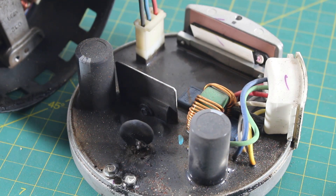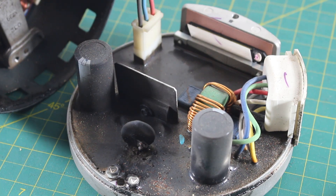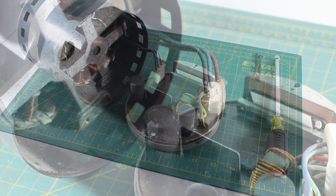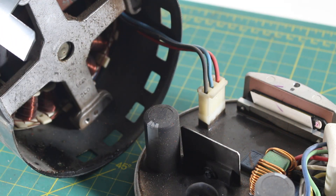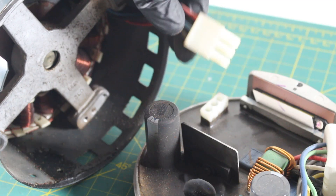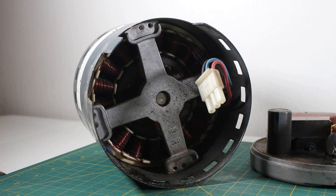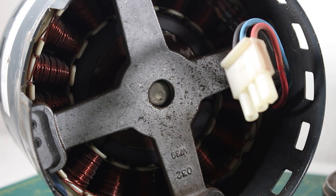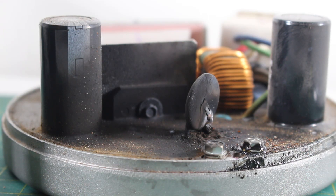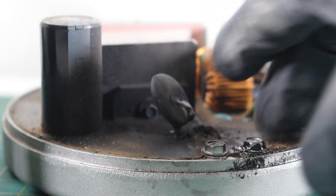Here's the module and as you can see, something burnt out in here, that's for sure. We have this clip here. Our main focus is going to be right here at this wiring harness. In the back there's a little clip which you can push down, and then you can unplug the motor from the module. This is actually really cool because inside you can see the copper windings. A lot of the time with these motors, it's not actually the windings that go bad, but the module itself. As you can see, this piece right here is crispy — it's basically broken off on one leg.